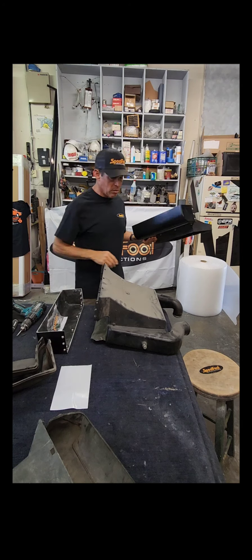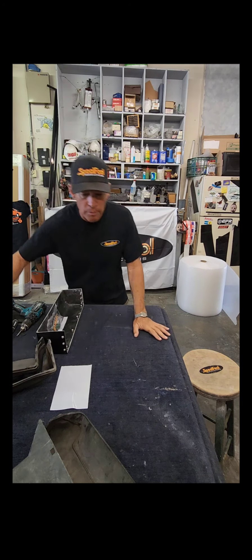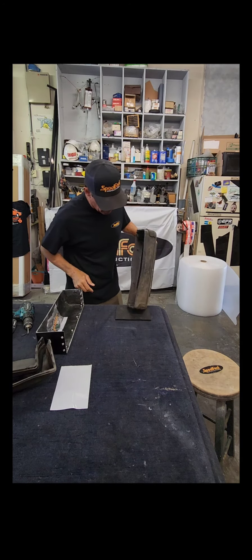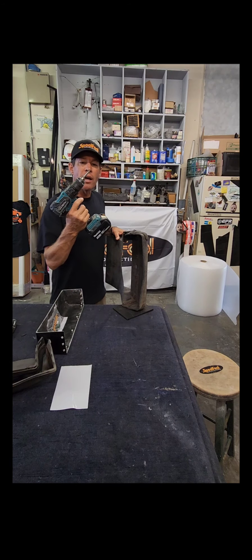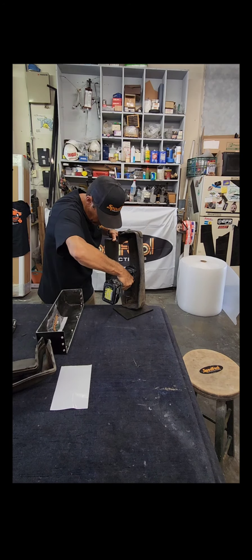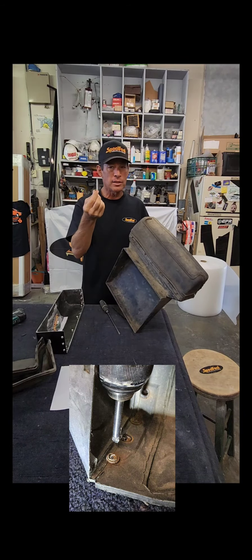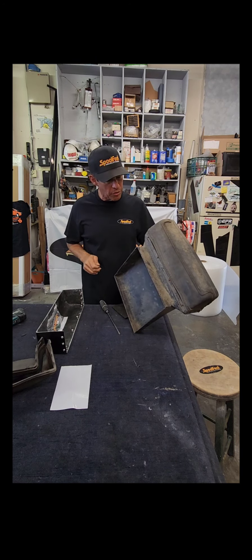When you put it flat on something, it gives the back of the rivet something to grab onto. I'm using a carpet table here - a piece of rubber is probably good to back it up with to keep the rivet from spinning, which is what you don't want. This little ball burr has a lot of little points of contact and it just seems to cut really well. Keep it squared up - there it is, pop out. These are steel rivets, not brass, so you've got to be smart with them and keep them squared up or they can be a pain.